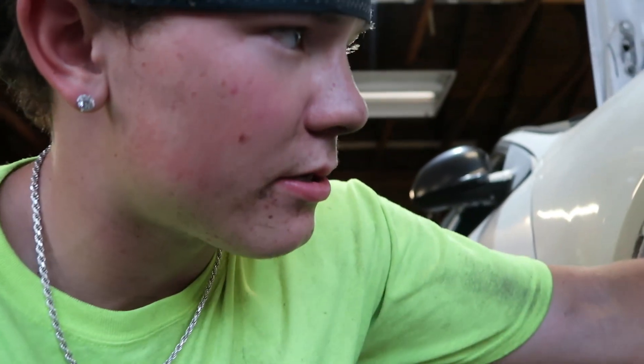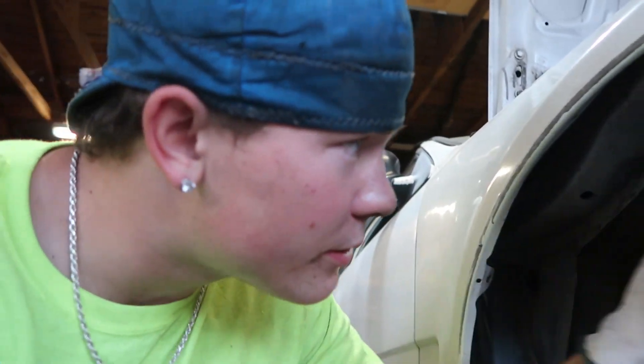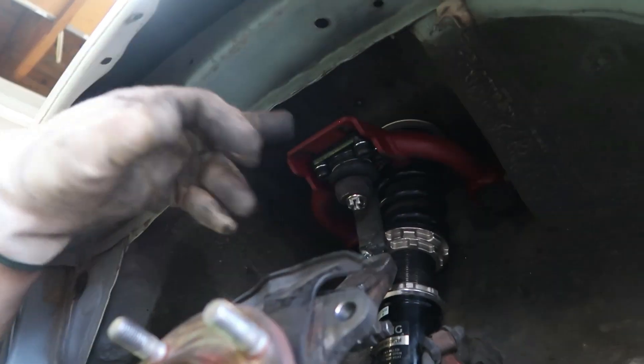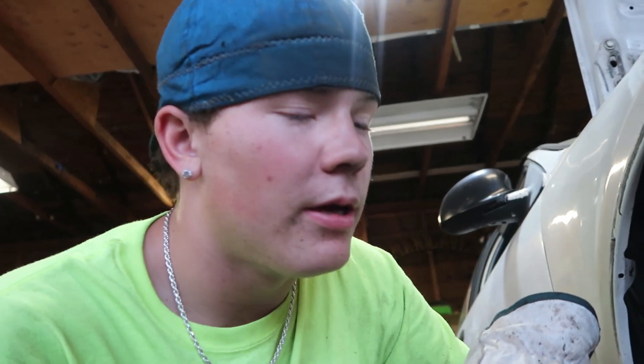The passenger side is tacked, angled, and shortened. It reads 18 degrees, but our top control arm adjustment is not maxed out — it's about three-eighths off. So if we push it all the way in and max it out, it reads 20 degrees negative camber, ladies and gentlemen.